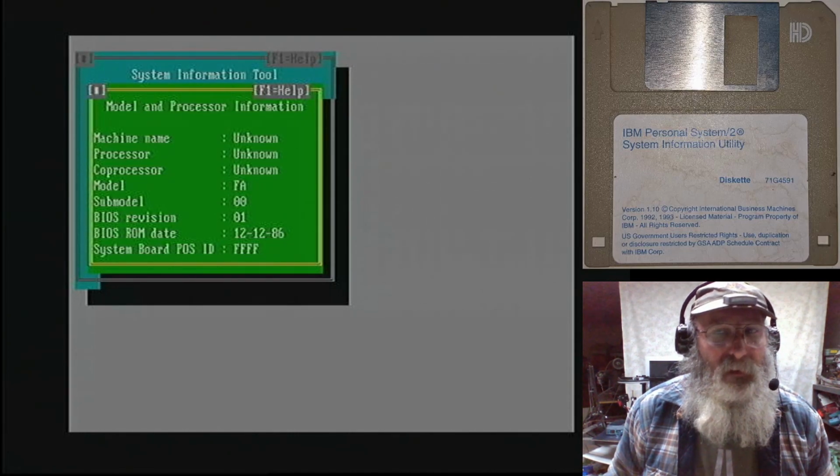286 and 386 levels, and the other earlier PC line with the 8088, the PC Convertible that I've shown in videos, that's a bit unique as well. It's the only model that has its own model identifier, even though it's an 8088 CPU. It's actually an 80C88 CMOS static CPU that's in the little PLCC package that's surface mounted to the system board. But since it's different from that 40-pin DIP type that's on the PC series, they gave it a different model number. So the model of the machine is typically related to the CPU.